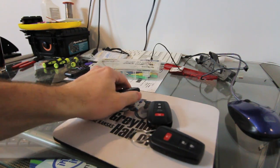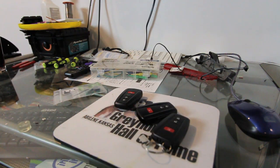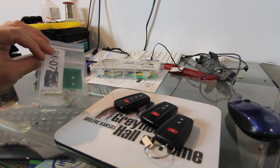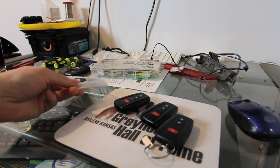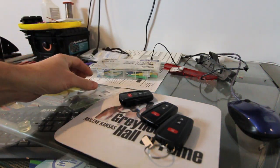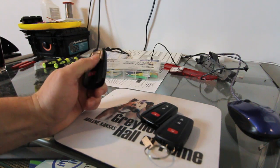Now what's cool about this is you can take any of these keys and write it vice versa. So your FLA board you could use for your Highlander and vice versa. To recap, and this is why I think it's so cool, these keys are stupid expensive, but there's unlocked ones that don't work all over the place. So you get your unlocked, you get your SLK-07, and I'm going to leave a link in the description for this from Southeastern Keys. You take your original locked key, put it in Tango, put in the emulator. It writes the key to the emulator. You take your emulator, you program it to the car. After it's programmed to the car, you bring it back, put it back in Tango. Tango reads it, you put in your locked key. Tango writes to your locked key, and you can take this back out to the car, fully functioning key.